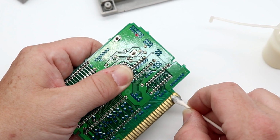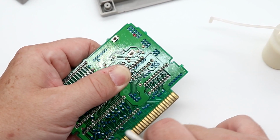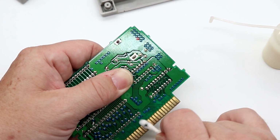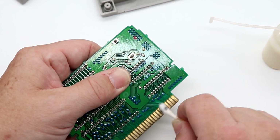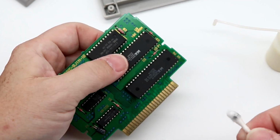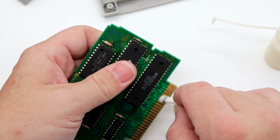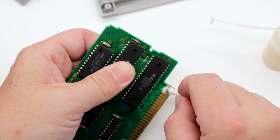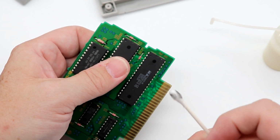Now, a lot of people say, hey, why don't you use Brasso? Why I went to Bright Boy over Brasso: like I mentioned, we found this testing RC car motors. There are dynamometers for those motors. We found that Bright Boy not only cleaned everything more completely, it flushed out of the motors more completely, and it actually did not inhibit current flow. If anything, it increased efficiency and current flow. So that's what we ended up getting out of that one.